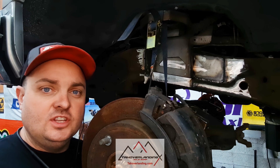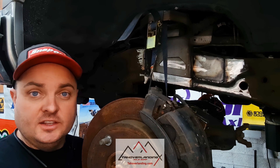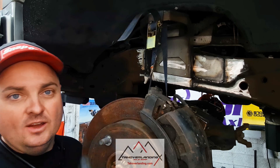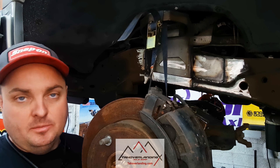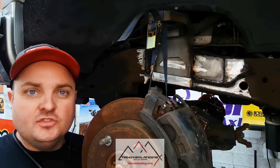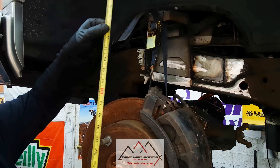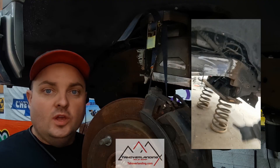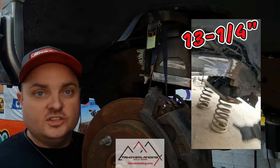Now it's time to talk about how to set the coil mounts and get everything mocked up. We already set the rear to the height it's going to be by installing the shackle flip the customer wanted, then measured from the fender lip down to the axle hub center on the rear. On this particular vehicle with the weight loaded in the back, we got a measurement of 24 and 3/4 inches. So we mocked the axle in place at a position of 24 and 3/4 inches to center. We also set the vehicle down on the coil springs to see how far they compress roughly under the weight of the vehicle to get a starting point.